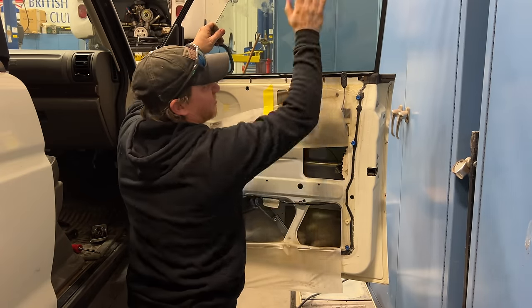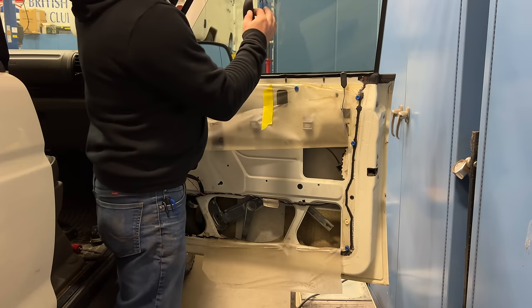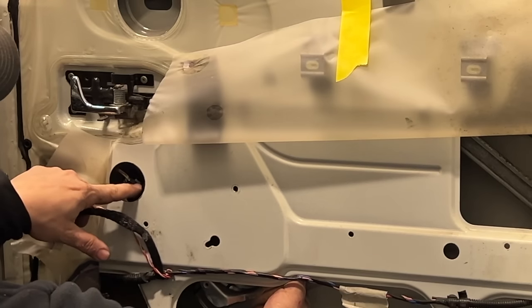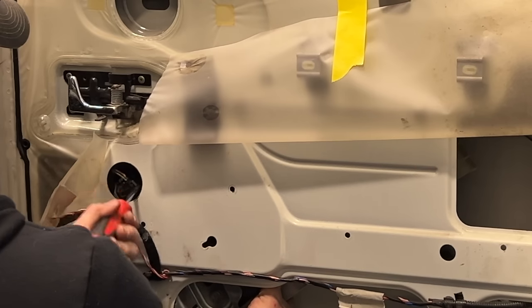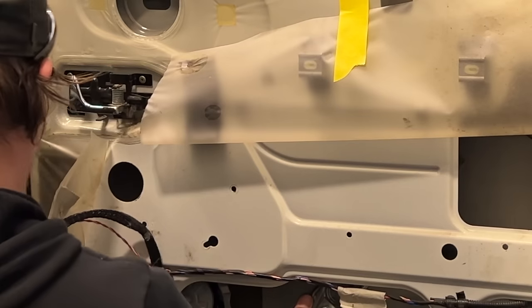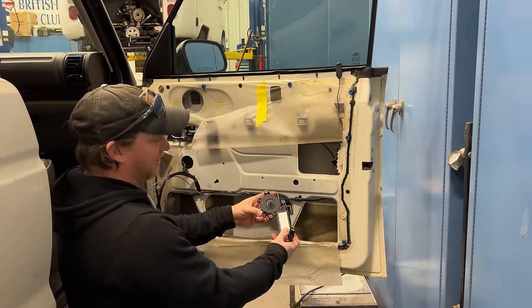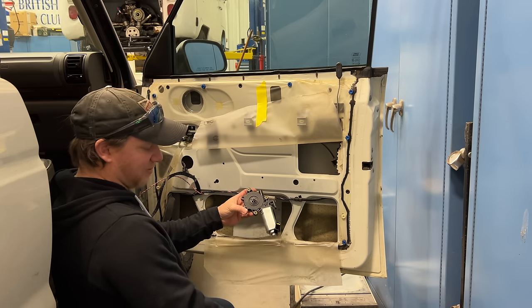Now that the window is disengaged, I can just pull it back up into the frame. This time I'm going to use a good piece of duct tape to hold the window up. Now I need to bring my motor up here. Here's the electrical connector — I just need to lift up on this little bit right here and the connector will pop off. And here's the motor that we've been wanting to get to. So here's my new motor. I'm going to plug this in first and make sure that it goes both directions before I put all of this back together.